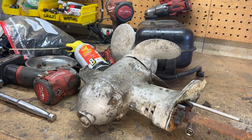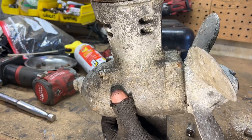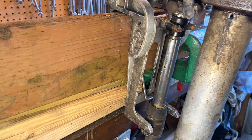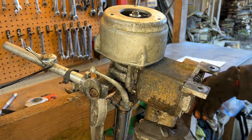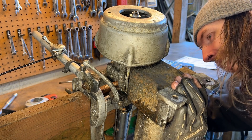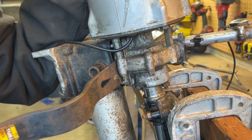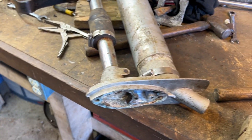That plug is about all I see at a moment's glance, but plastic impeller. The gears do not feel terribly chewed up - boy, there's a lot of backlash though, look at that. I can see we're at the top of the stroke on the rod, so that's what's holding us up right now. I don't know anything else I can think of that doesn't involve splitting the crankcase and pulling that rod out. It all depends on how stuck that piston is in there - it is feeling pretty stuck. Not taking a look at getting this base plate off, but yeah, that's stuck.